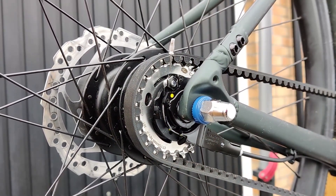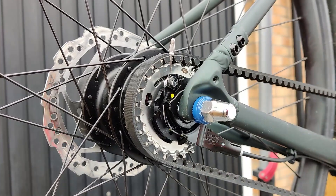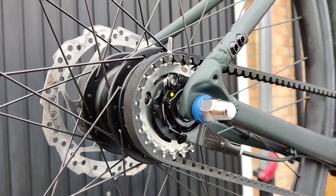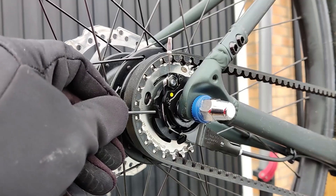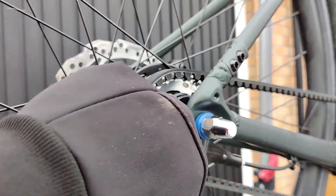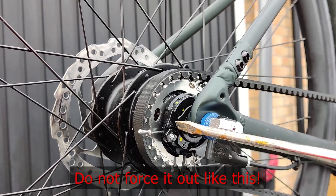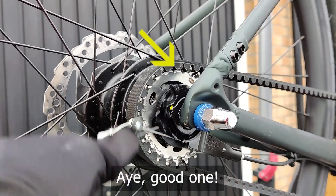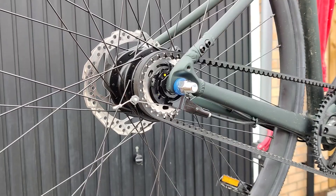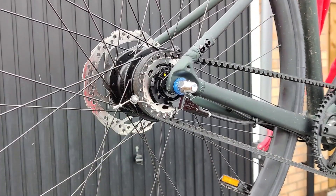Now the process of getting this back wheel off is actually fairly straightforward. Along here you can see the shifter cable — it comes up and routes around into this bit here. In essence what we want to do is pull this little bit out and that then disconnects the cable from the hub itself. To do that, I put something small in here — I'm using a small allen key because I'm fitting the mudguards. Put that in and then we can adjust this — this is on a spring — we can adjust this here and then we can pull that little bit out. That means it's a little bit stiff, needed some persuasion by a screwdriver, so you can just pop that out there like that. And that's the shifter cable free of the hub itself. I think we also have to take this little bit of cable out here because this black part is also part of the hub, so just as a precaution we'll just take that off as well.